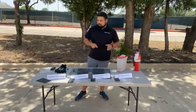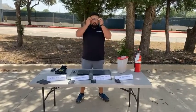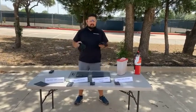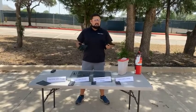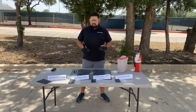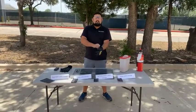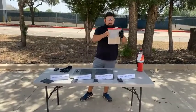To get prepped before I puncture the first one, I'm going to put some safety things on. Safety glasses are a must to protect your eyes from anything that may fly. I have some fire gloves — these aren't required, I actually got these with a fire pit, so they're not really phone repair related. But this is going to protect my hands because this does get very hot. And something that is very cost-effective that you should have in your shop is a battery remediation kit like this right here.